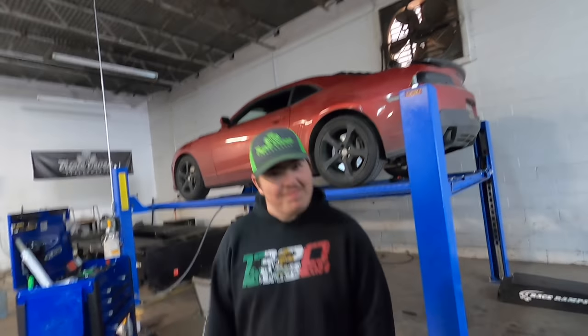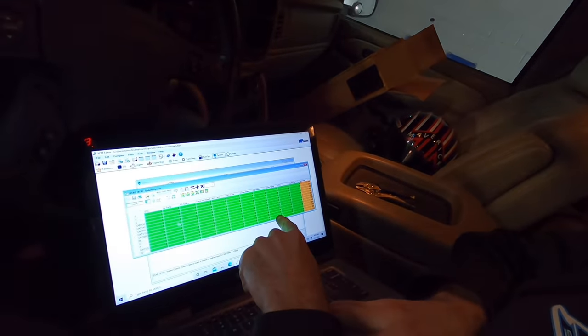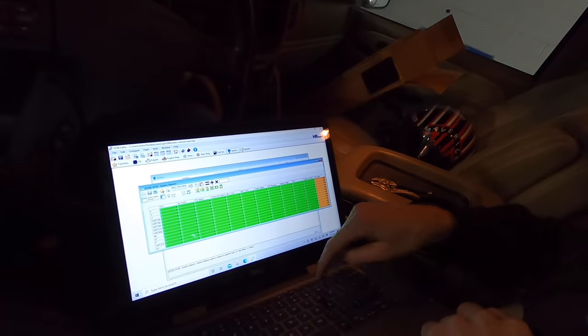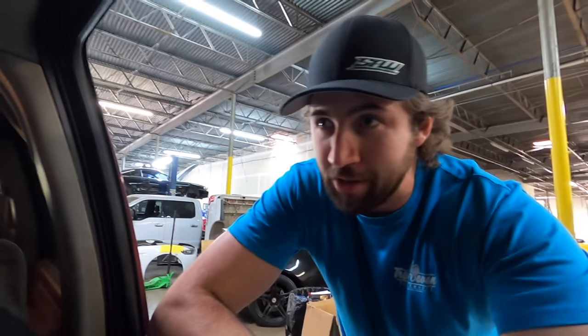Are you ready to get back to Yellow Belly? Yes. I was wanting to go last night — me too — and then it rained. This is a big deal: brake torque management. See that one there? Setting that to zero will make this thing able to do a burnout. Even on a bone stock vehicle, change that one to a zero and you can do burnouts.